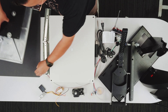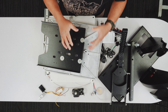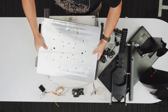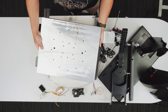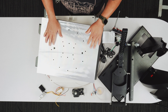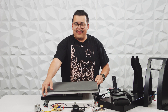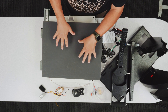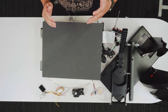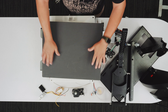I'm going to call this next part the backbone because it supports what you're doing — this is the lower platen, partially assembled. This is the plate that supports everything: your t-shirts go on here, your sublimation blanks go on here. Because you don't want a metal-against-metal surface when heat pressing, we have our silicone pad — another key element to the lower platen. This silicone pad absorbs the pressure and helps distribute it evenly on your garments, which is a really big part of how we're able to get such fine, consistent pressure distribution throughout the entire surface.